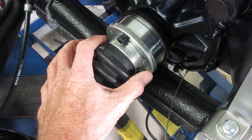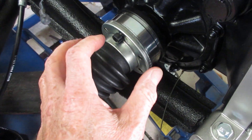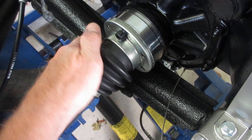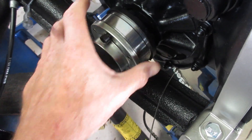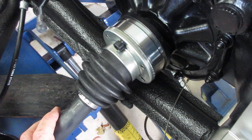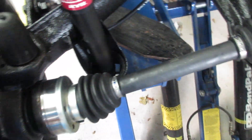So take note of that when you buy these new axles: slide this back, take that extra grease, and pack that constant velocity joint all the way around. They slide in and out — you can push and pull the grease — and you've got to get the thing full. I just couldn't believe it.